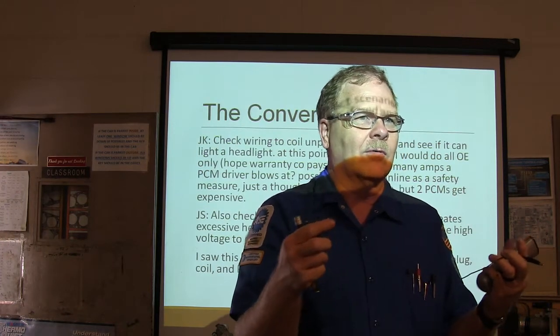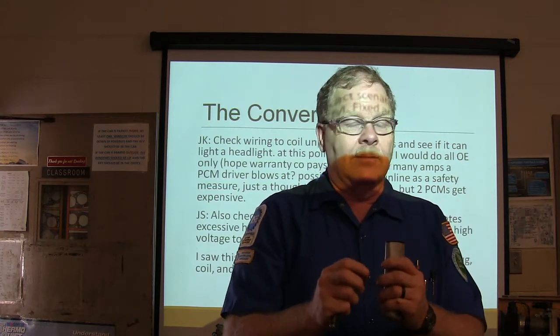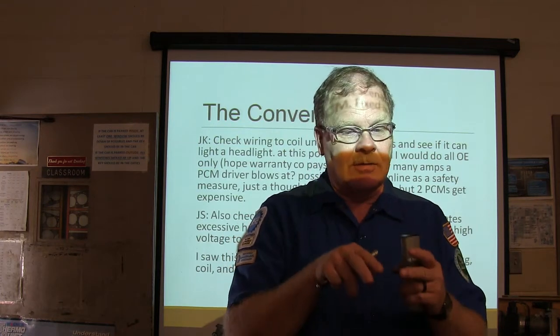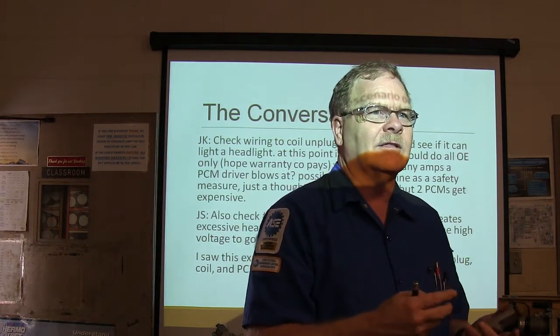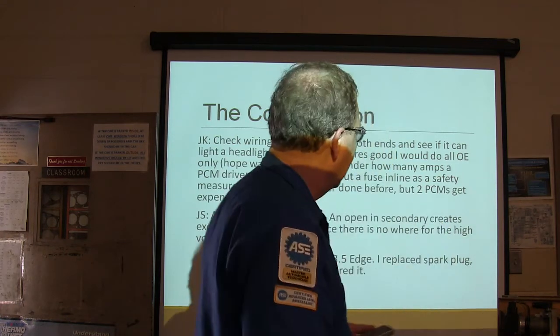I got a video about that where we had a Ranger one time that got to where it wouldn't start. The pump wasn't running. You could take a test light and go in there and it would light that test light. But when you took a headlight bulb and hooked it up to that same circuit, that headlight bulb wouldn't light. A headlight bulb pulls about as much as the fuel pump. That meant we had a bunch of voltage drop on the ground side, is what it turned out, and we had to run a ground overlay on that one.